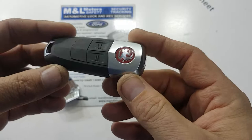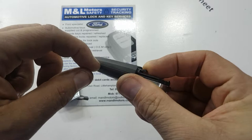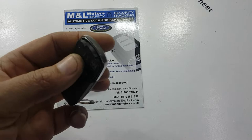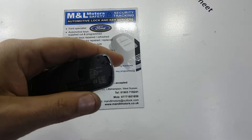These keys aren't the best of hard-wearing keys anyway, so after a while they don't look great — the last thing you want is big gouges down the side of your key. The way to split this key apart is quite simple. With the metal cover off the end, and the emergency blade removed if it were there, we're just going to take a flat-bladed screwdriver.